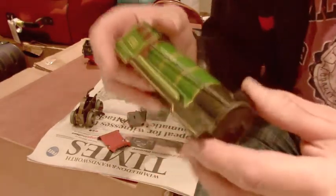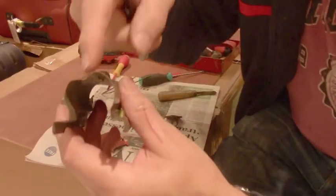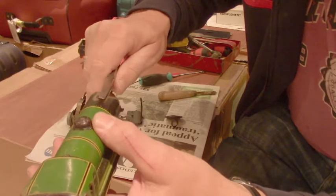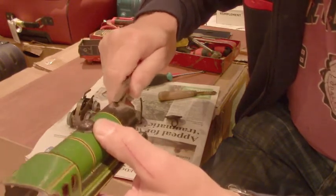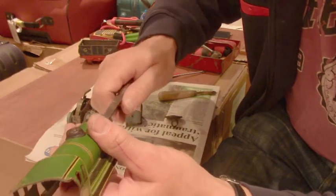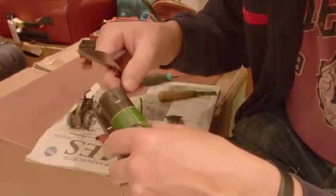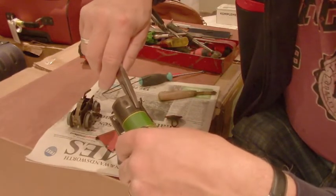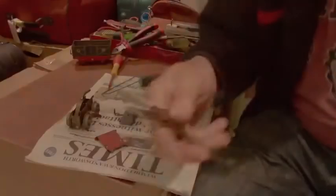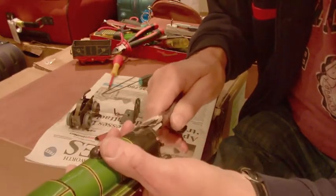It shouldn't take much, and you can see the indentation right in here — very bad. I'll just see what I can do with it. I've got the part now, you can see the dent here. We'll just go gentle with the pliers first — very gentle — and it is coming out. Take it by the crease and bend it up a little like that. It's coming nicely and beginning to shape already. You want to be very careful not to damage the paint too much — use very clean pliers without any grip ridges inside. I'm going to put a bit of masking tape inside the pliers to protect the surface.